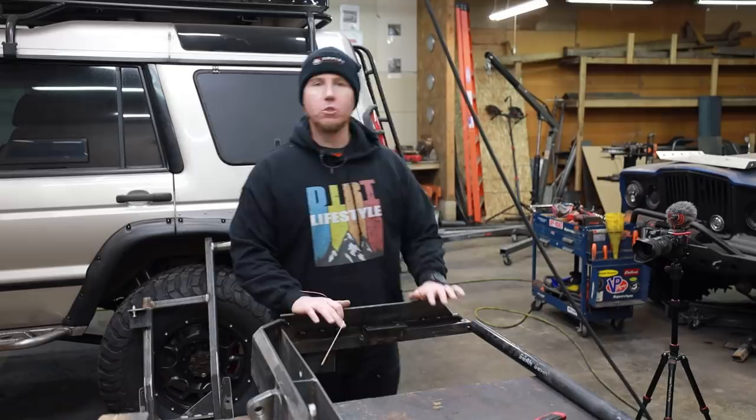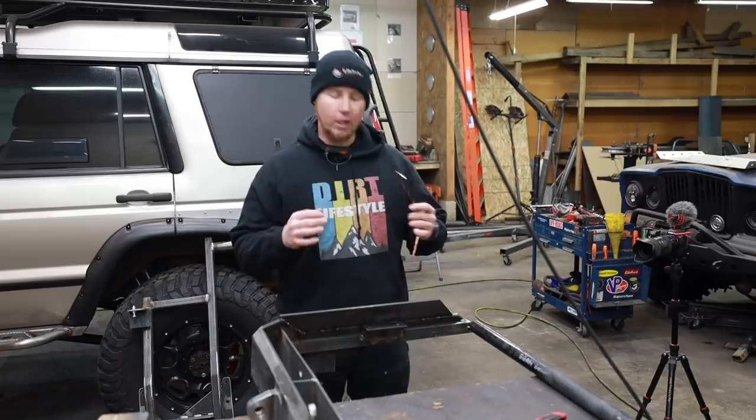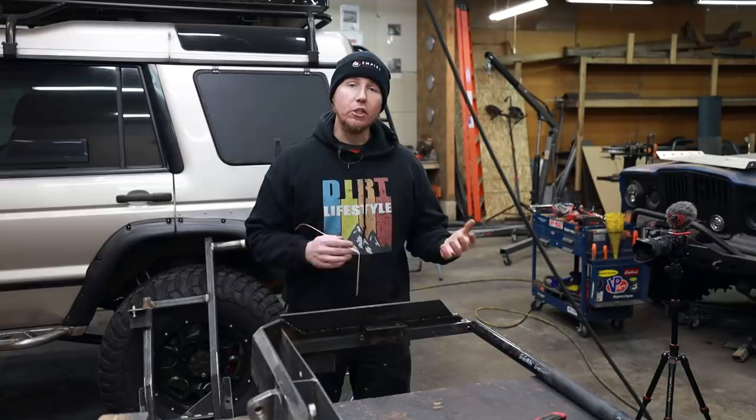This corner is going to be so obvious if we warp it because of the marriage and the reveal between the top of the bumper and the bottom of our armor. So in order to make sure that relationship looks good and doesn't change on us, we're going to take a couple extra precautions. I'm going to weld slow, and we should know if something pops or if it's changing shape.